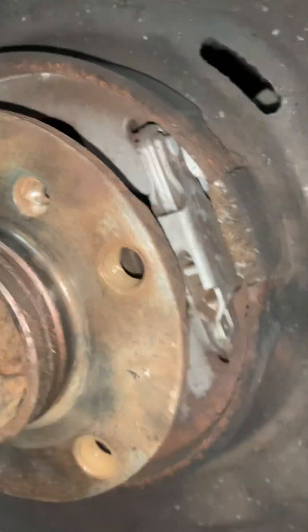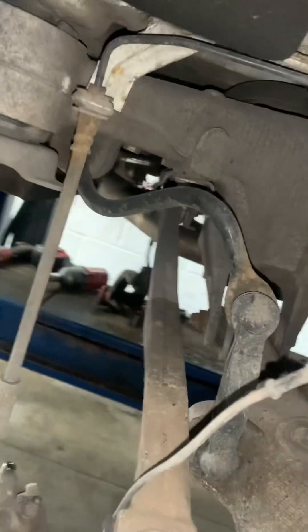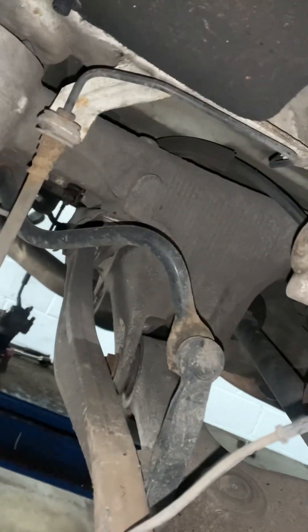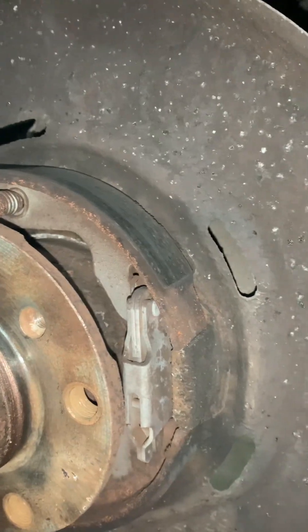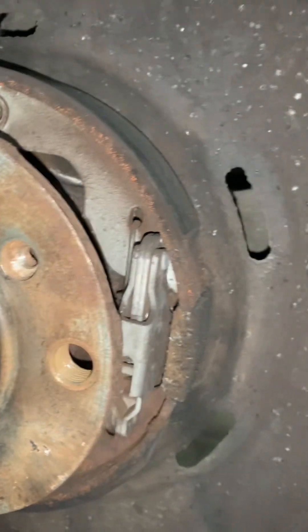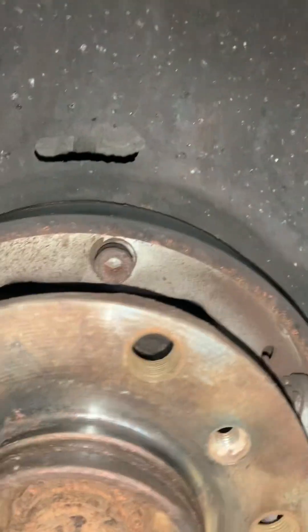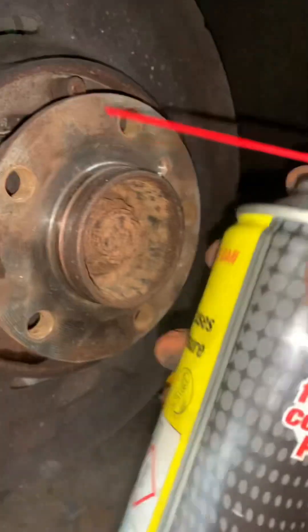Now we need to get to that little piece in there to release the handbrake cable, then unthread it all the way back to the module under the car - up and over the subframe as it comes out, same as it goes back in. We also have to disassemble some of the drum brakes for this - always a good day when you're messing with drums.